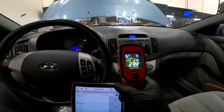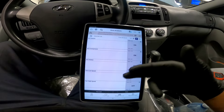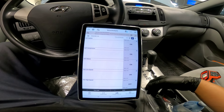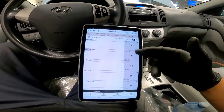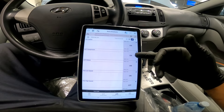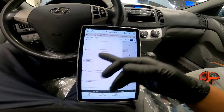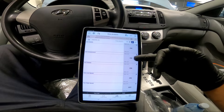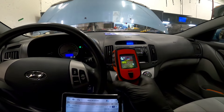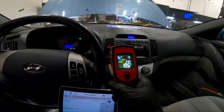Definitely a low refrigerant issue - that's also why the cooling fan wasn't turning on. We had basically no refrigerant in the system, only two ounces. I was puzzled earlier why the compressor turned on with such low refrigerant, but it did turn on after we hooked up the machine and the clutch was engaging. Now the vent temp is down to 18 degrees.